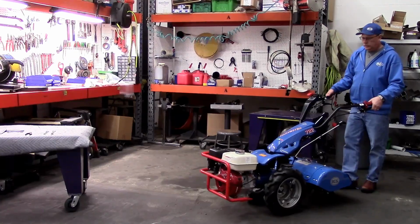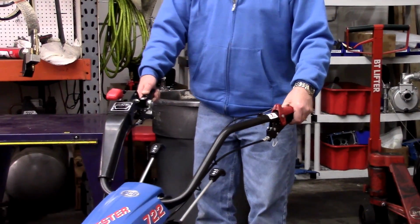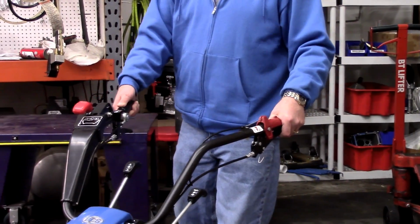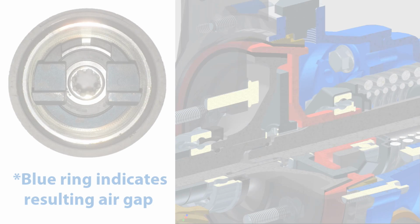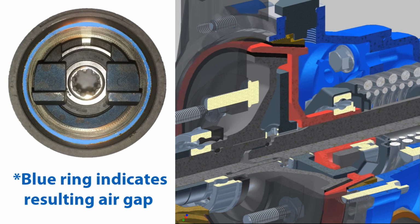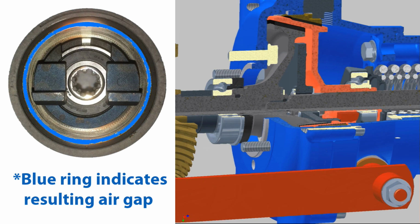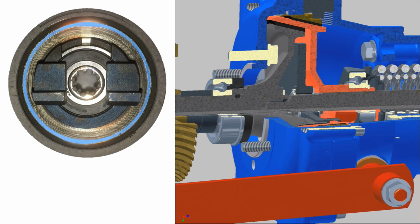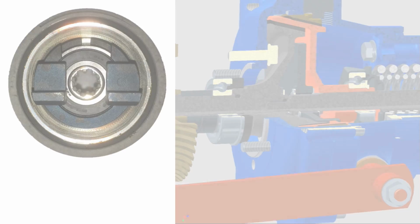This creeping of the wheels generally signals that the clutch cable has stretched, something that often occurs shortly after a new cable has been installed, and always occurs as an older cable wears with use. This lengthening of the cable means that squeezing the lever is not separating the two cones within the clutch. Because there continues to be some contact between the cones, there is still sufficient power transfer to rotate the wheels, albeit slowly. To achieve full separation, we need to shorten the cable.